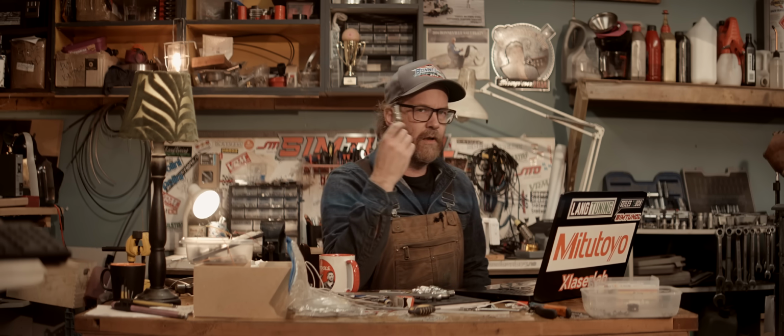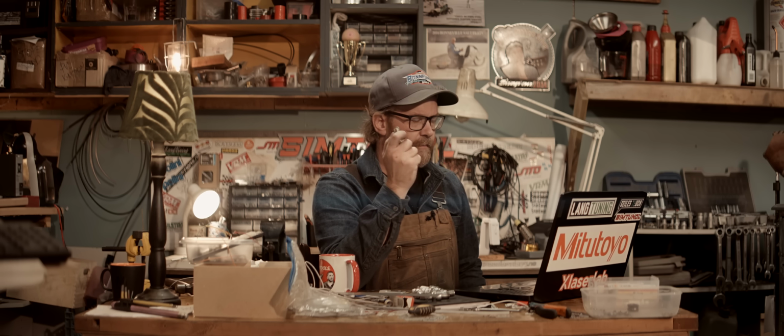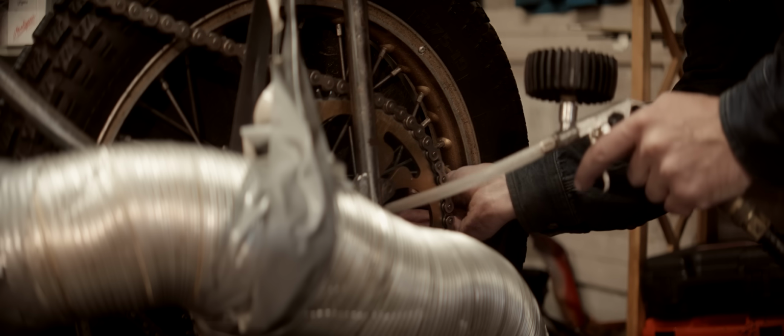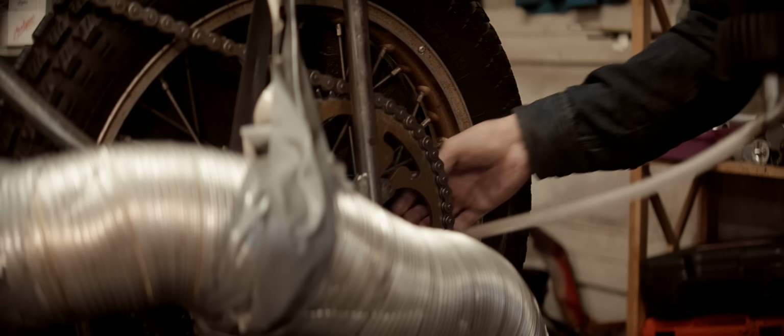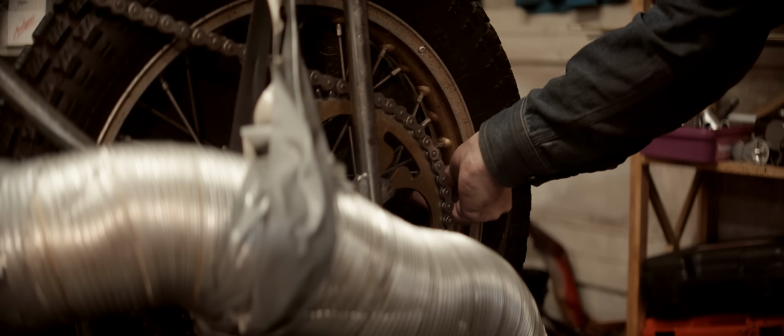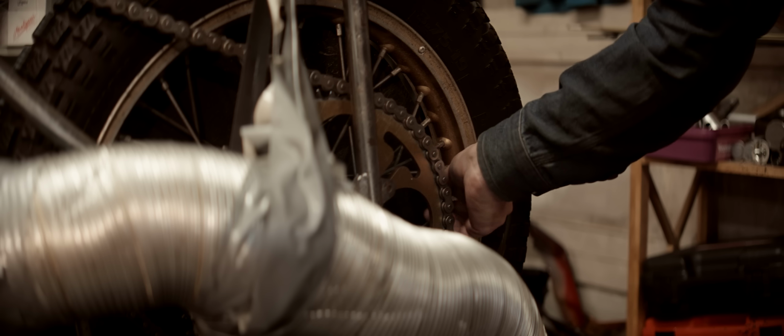I'm gonna put in a new plug with just a stock gap, and we're gonna do 3 runs. See how it behaves. Hopefully the ignition system is back to normal again. And I've made sure the wheel is always staying at 3 bars of pressure. Forgot to mention that earlier. That's what I used for the coast down run, and that's what I use for every session now.